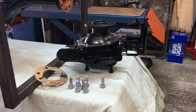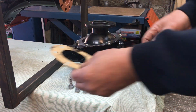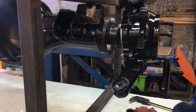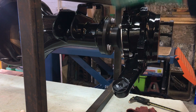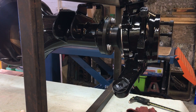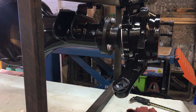I've fitted these seals — just banged them in with a 52mm drift, pressed in with a mallet. Didn't try the press because if the swivel's slightly off the seal gets pushed in at an angle, so better to feel around the edge, make sure it's square, and just keep tapping. I'm going to fit the swivel bolts initially with no thread sealant, get them all on, then take them out one at a time and apply Hylamar — my favourite gasket sealant — around the inner edge, then bolt it all back.